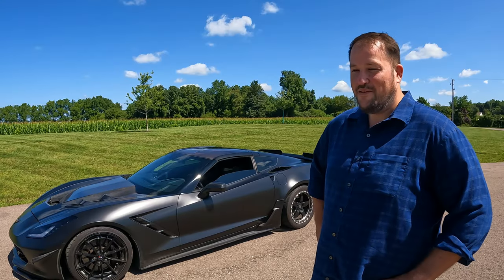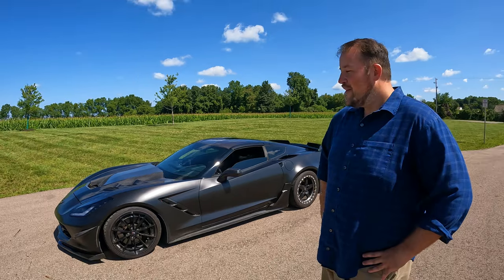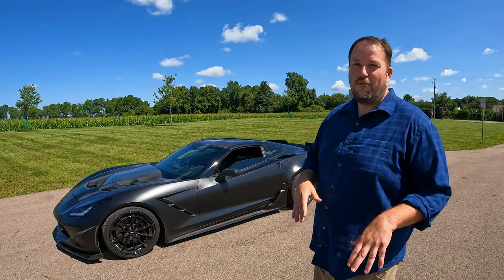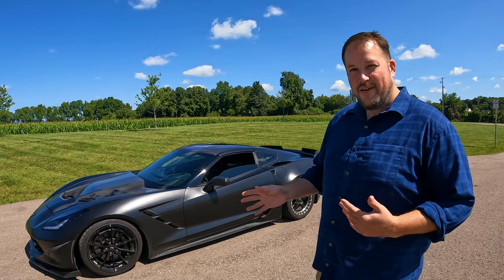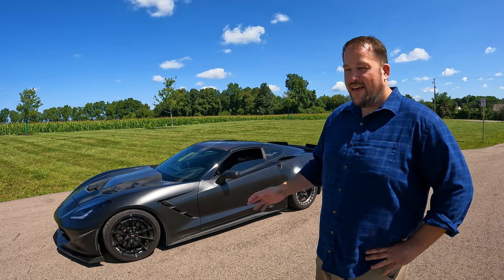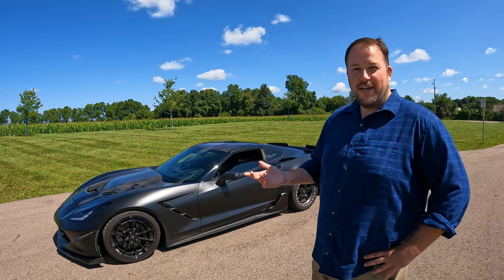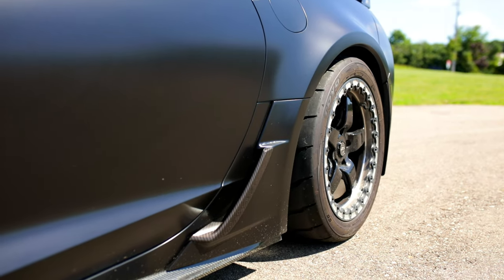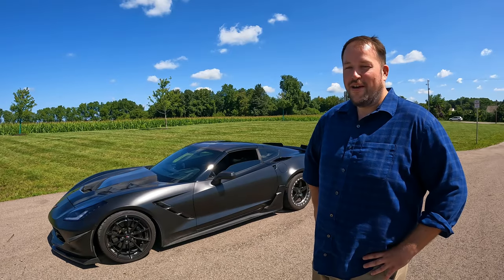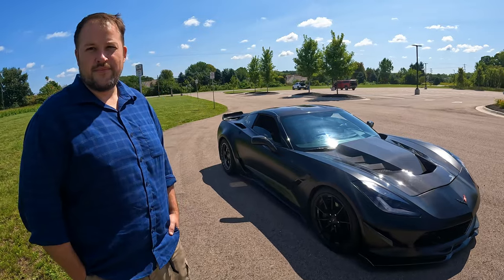He's heavily abused it for about two years. It's an F1A94 ProCharger — the biggest air-to-air ProCharger you can get, supposed to max out at 21 pounds of boost. He's running it at 23 right now, so he's slightly overspinning it. He had it rebuilt just to check the bearings and they said it looked pretty good. Eventually he'll swap over to air-to-water and go with the F1X.